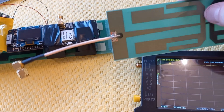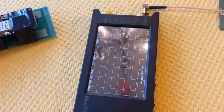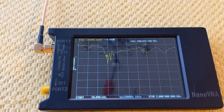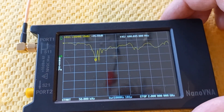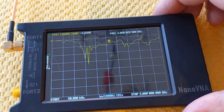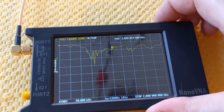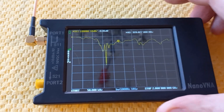The wire wasn't tied down yet, so I brought it down with me. What's really cool is I've taken out the antenna, which was glued in — I snapped it off — and we're now going to look at it on the VNA. This is actually a broadband cellular antenna I was using. At the time I didn't have the VNA meter so I just thought let's try it. Here is its response — it is most resonant at around 600 MHz, which is right where LTE starts. Everything else all the way up to 2000 MHz is kind of mediocre. That's where we wanted to be at 906 MHz.